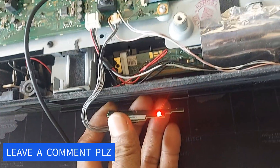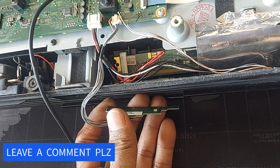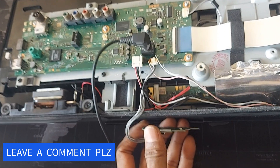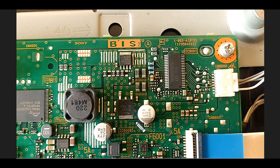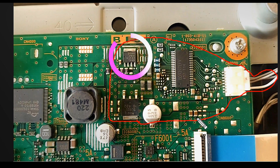When you see a Sony TV indicator blinking six times, in most cases you can assume there is no problem in the circuit board. Try to understand carefully — this is the backlight driver circuit for the backlights. This MOSFET is used to convert 19 volts DC to AC.